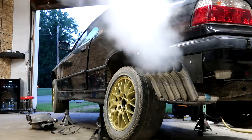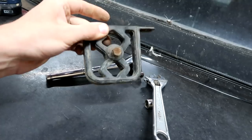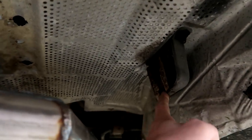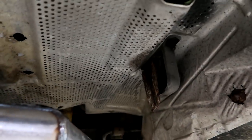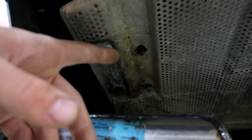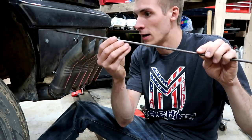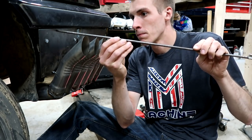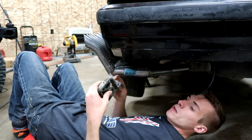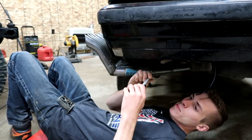Creeper's hung. I don't know why that sounds so satisfying, but it is. Remember yesterday when we fired this thing up for the first time? So I didn't finish mounting the exhaust exactly where it's supposed to go. I removed one of the old brackets — it's right here, the other one's right there — and as you can see it rotted off the old muffler and it's not going to benefit in any way. So you gotta use these mounts right here, these bolts. It looks like I have an inner and an outer to choose from. I made a mark on this piece of steel and a mark on the car, so when those two line up I'll be set — slightly off, but when we bring gravity into the mix it's going to screw things up a little bit anyway, so being high is good at this point.